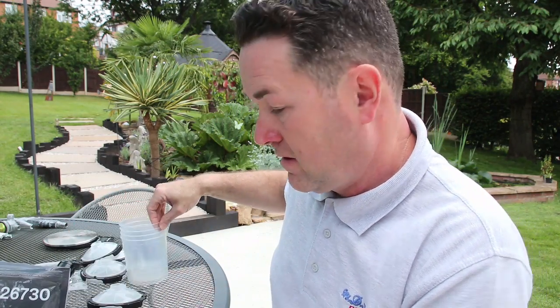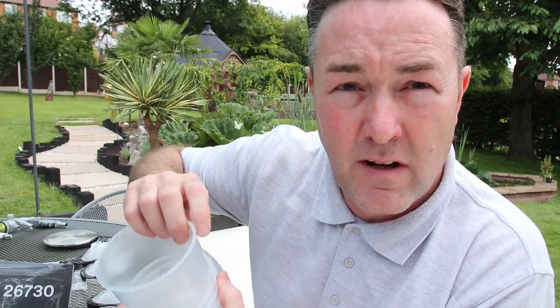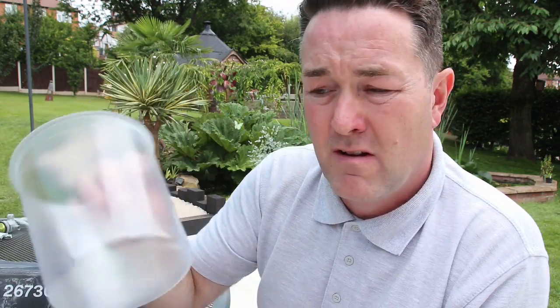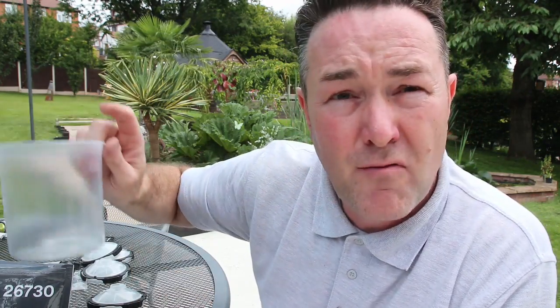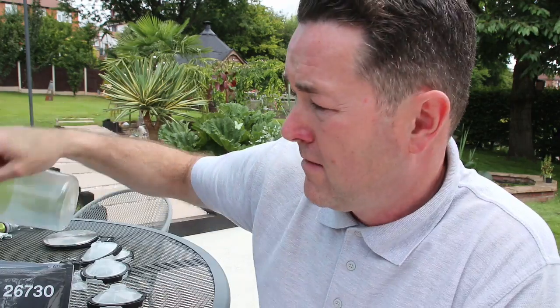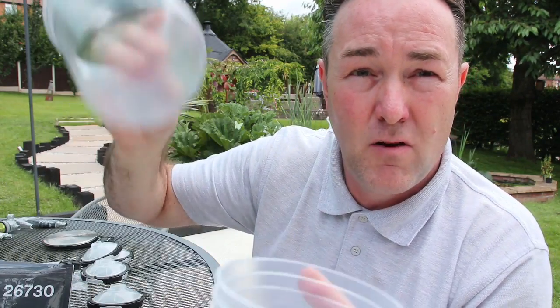So you've got throwaway cups. These are throwaway. If you're using something like a cellulose, you're using your colour bonds, you could tip out your paint from that, bin it, because you can buy these. 3M do these in various sizes. Do a bit of googling about the throwaway pots for the PPS system and you'll see different sizes. A bit smaller, thinner, longer, you get more in.